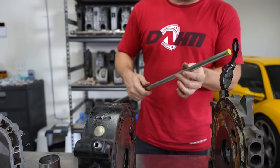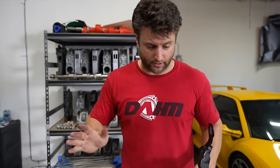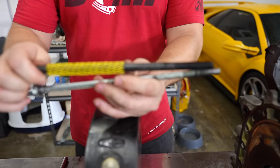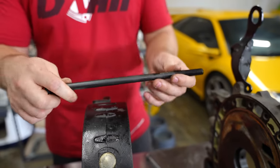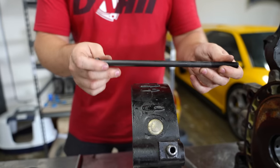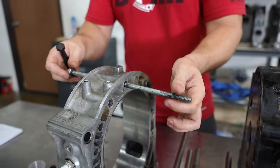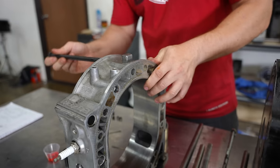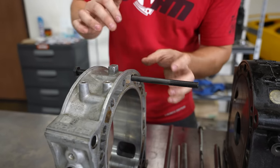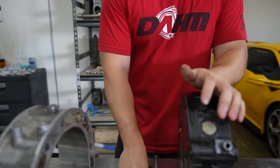Pineapple Racing sells actual machined and ground stuff for that exact purpose. I get raw material from machine shops — it's cheaper but I have to do more work. I would do a solid dowel kit — that would be a major upgrade as you start making power. There are also a couple of upgrades for the tension bolt itself. This is a kit from Atkins — they do a lot of things well, but this comes with a drill bit and tap to enlarge the threads. It doesn't solve the problem I'm trying to solve. Looking at the stock dowel, it does nothing to prevent torsion, rotation, or bulging — and sadly this kit doesn't do much better. It's stronger and will keep things clamped, but you're modifying your engine without addressing the core issue.